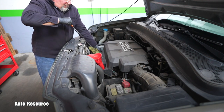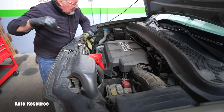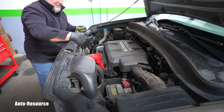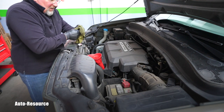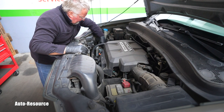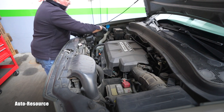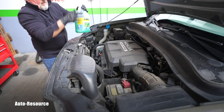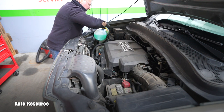When you're done pouring you can always recheck with the dipstick, but normally 4.5 quarts perfectly tops it off. It's a little bit above the top mark — when I start it up the level will slightly drop and it will be perfectly on the top mark. I already checked the coolant, power steering fluid, and transmission level. The windshield wiper reservoir isn't full, so I'll top it off with winter fluid — it's not missing much.